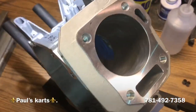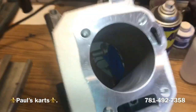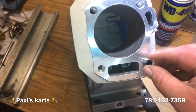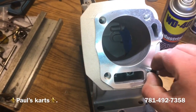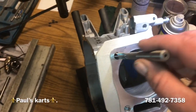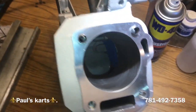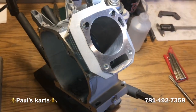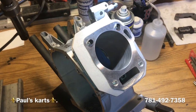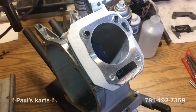On the dowel pin holes — normally they're down here on a Honda block, that's where they come stock, and they won't fit up top. But now that we've reamed them out to 10 millimeter, the dowel pins fit up top as well. So we can get the hemi head on the non-hemi block. That is how you prepare a block and clearance it for the cam, and that is how I set up the heads for a hemi head to go on a non-hemi block. I do it on the block, not on the head.